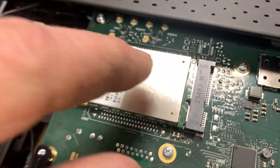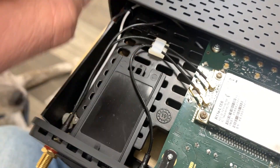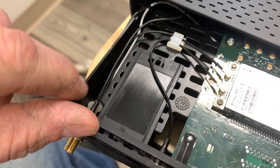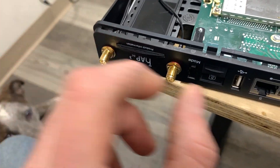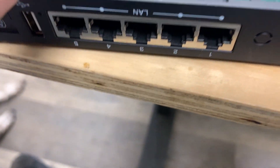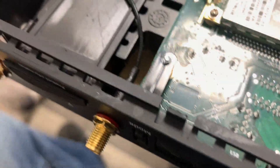Once you get it apart, it's really simple. All you do is go to the LTE radio, disconnect the two antennas that are on there — you can see that white wire, another one tucked under there, and the hot glue left over. You pop the two covers off on the front, put these connectors in, and connect your wires to the LTE radio. You can do the same for the Wi-Fi — there are two spots here, and there's your Wi-Fi right there. Very easy.